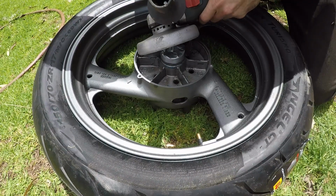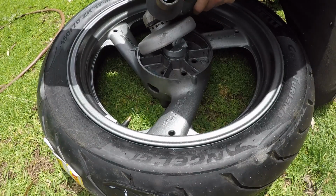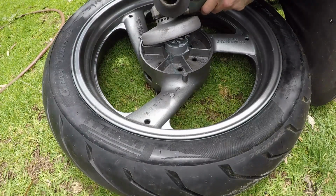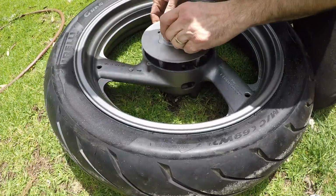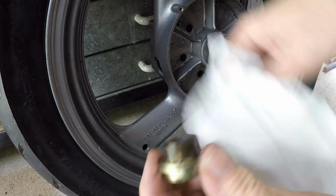So what I do first is just take the neck out of this radius, so just square it off a little bit to allow that plate to go in a bit further, and then I remove that bush that's in the end of the drive plate and turn it down so the whole plate can sit in a bit lower. So here's the bush.